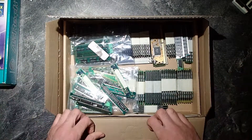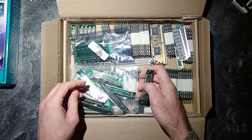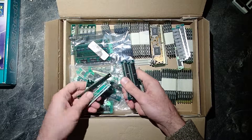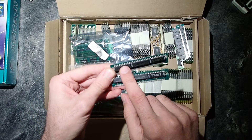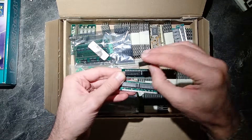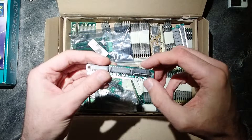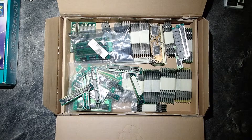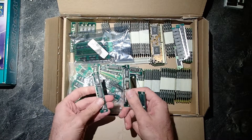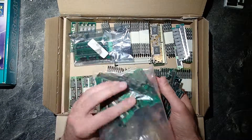Today you can easily buy a lot of SIM memory sticks on eBay and they are cheap like dirt. Some time ago I bought a box full of memory sticks for a couple of euros, and there were quite a lot of 256 kilobyte sticks among them. I asked myself: what is actually the difference between a DIP memory chip and a SIM memory stick? After a closer look at some of the 256 kilobyte modules, I realized that some of them use the very same DIP memory chips I could put on the mainboard. In addition, the third chip on the module is usually the parity chip we need. So as an experiment I decided to disassemble some of the memory modules and grab the required chips from there.